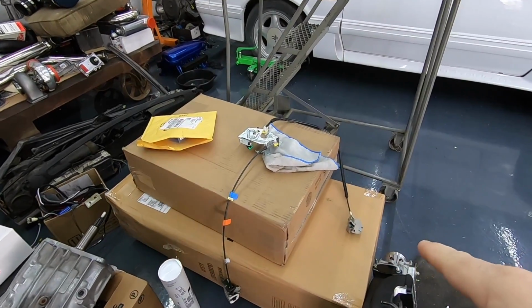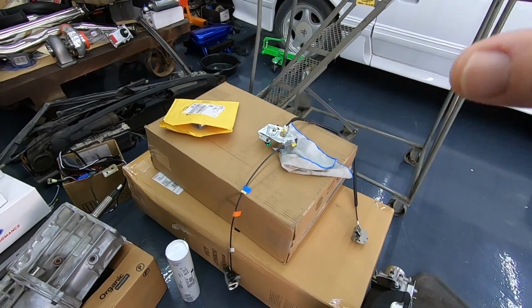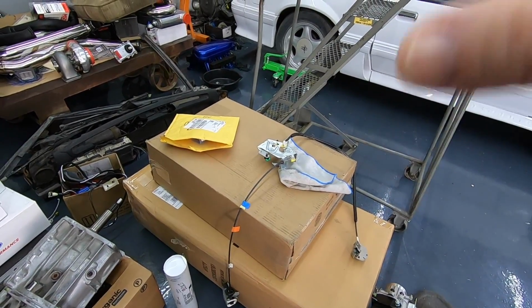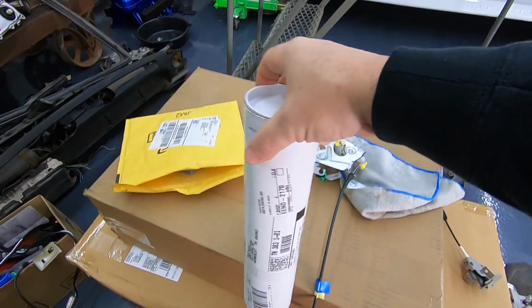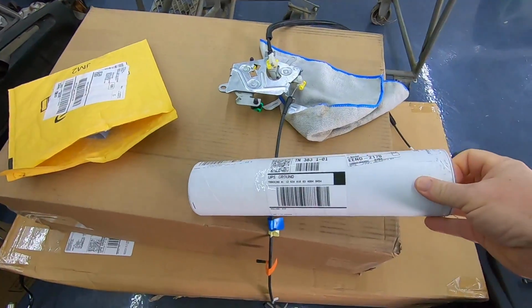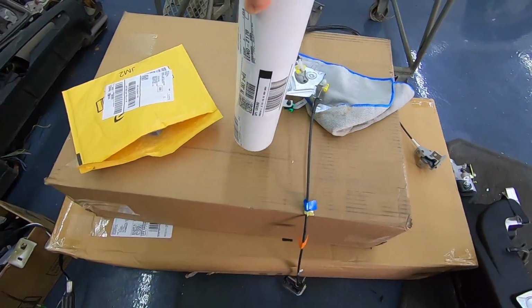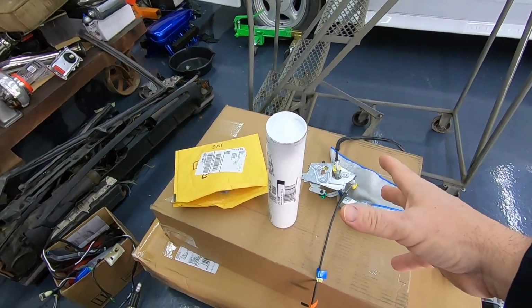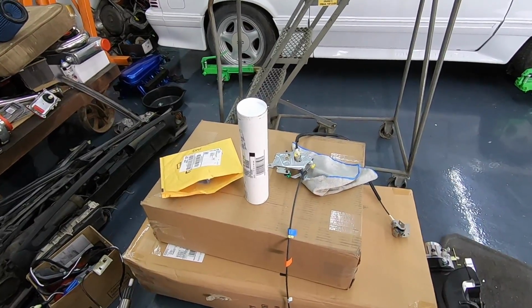Can't wait to feel this in a notchback on tire. It's going to be an animal. This last and final bit of parts we've got right here. We're gonna have the 6R80 completely redone, all new clutches, stronger billet input shaft, all that good stuff. So the 6R80 will be plenty solid. This is actually the input shaft right here. Can I get it out? Nah, probably not. But anyway, boys, there is the input shaft. Where did he get this from? Reese Racing? Who knows? But anyway, upgraded input shaft. We're going to do the clutches and stuff like that. So have the transmission rebuilt, and then of course put the converter in at that point. And she's going to be mean.